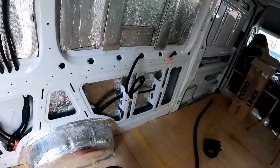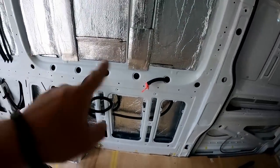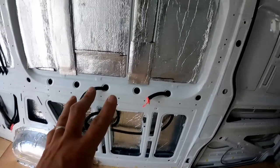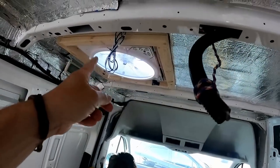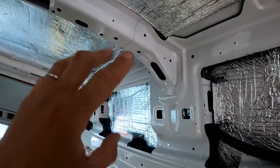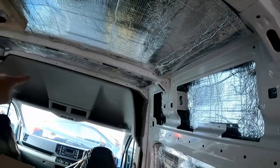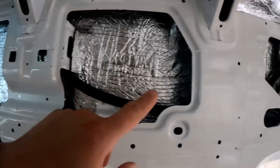So, like I said earlier, not sure which one yet, but one of those is going to be for the 240 volt, one of those is going to be for the 12 volt. So that's the 12 volt supply from this side. We've got 12 volt supply coming here, that's going to be for the Maxair fan and some lights and bits at the front. I haven't run it yet, but I've got one more to do that's going to be from the shower, any lights in the shower, and probably some lights underneath in the shelf there when we build that. So that's going to run across.